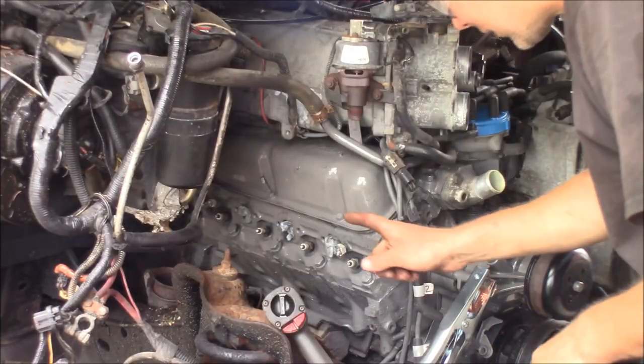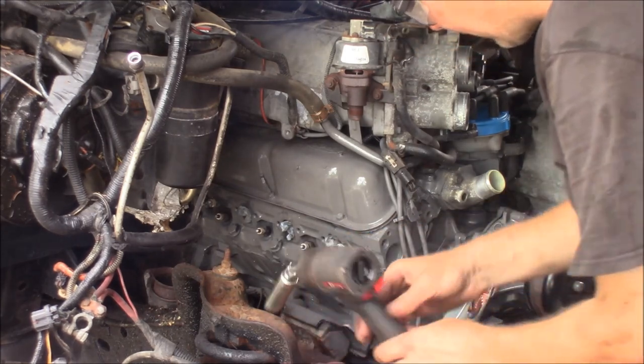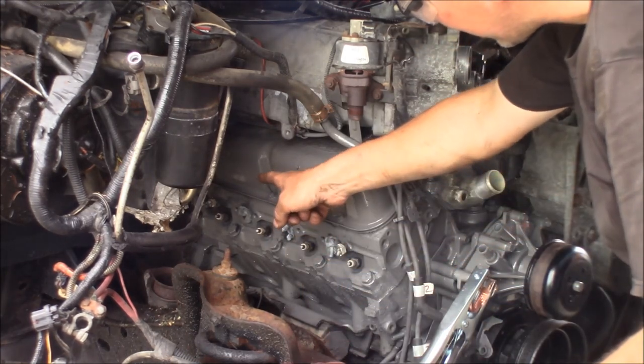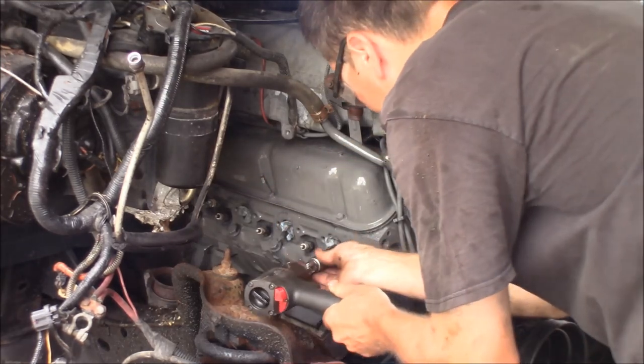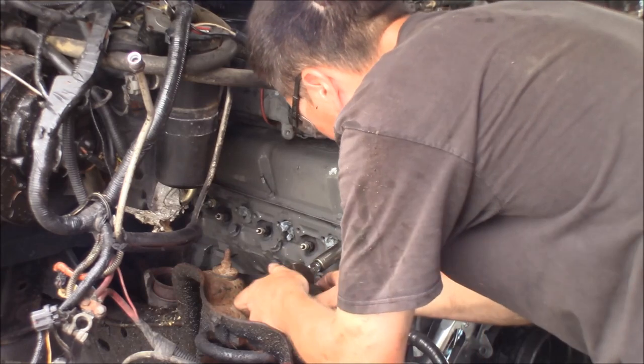I'm back on this side — I just welded a nut to this broken-off stud in the head. I tried welding to the broke-off stud in the head with a nut on the back. These are kind of warm so I'm going to try it while they're warm on the impact and see what happens.